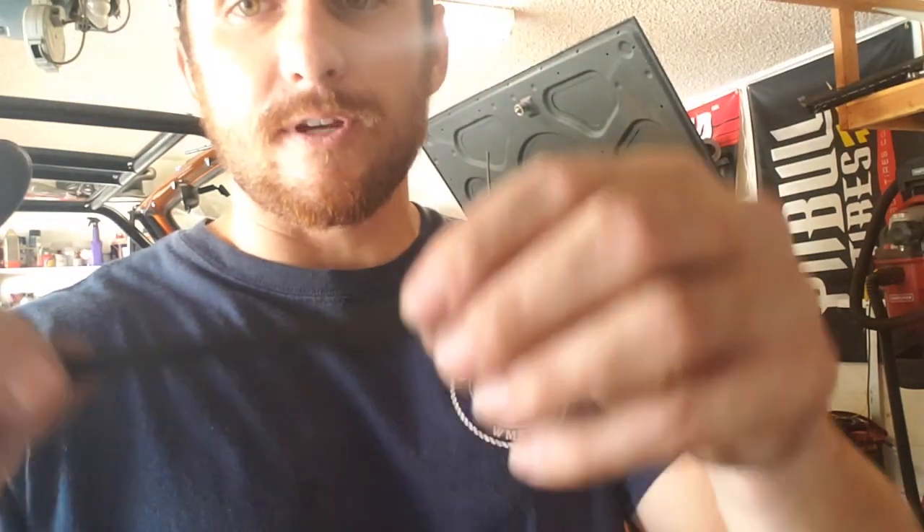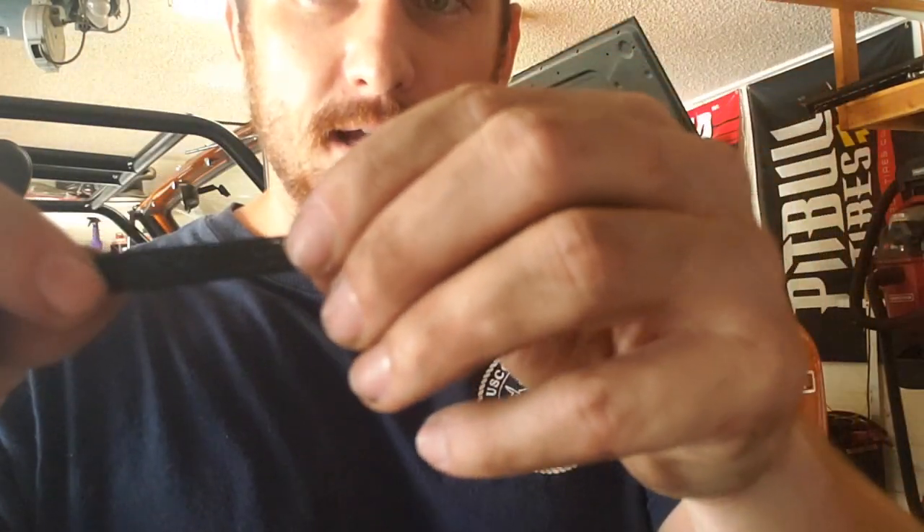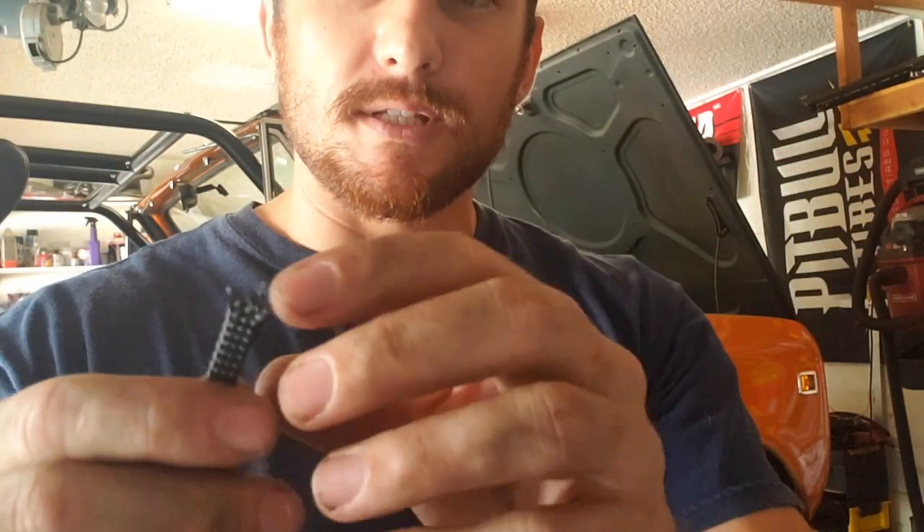You're going to do the same thing on the other ones. I'm just going to de-pin the connectors I have because I already used both of the back connectors. I'll go ahead, de-pin them, slide them through, and then move them with the new housing. For the back, to help it look kind of how factory was, just a little cleaner look, I'm going to use some of this — it's called Ultra Wrap, it's a wiring loom. It's kind of like a Chinese finger trap: just put it on there, you expand it, makes it easy to put on. Then you pull it tight. Usually what I'll do, because the end starts to fray, I'll burn them and then put some heat shrink on them in different sizes, and it can look pretty good.